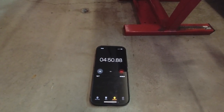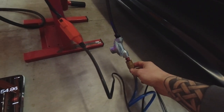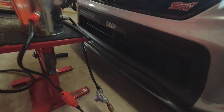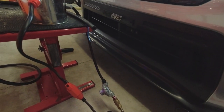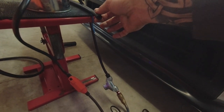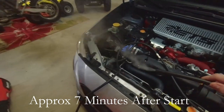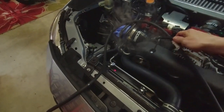You can see it's been almost five minutes. We hooked our airline up to the pressure regulator and you can see it's smoking pretty good. The longer it sits — say six, seven minutes — you'll have some really good thick white smoke coming out of there. And then that's when you just attach it to whatever you want to check for leaks.